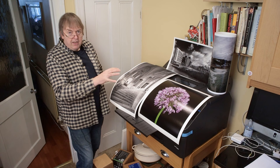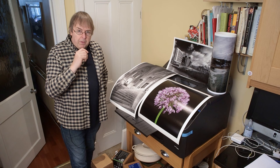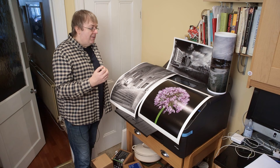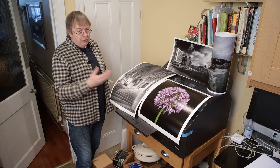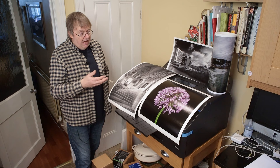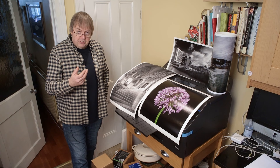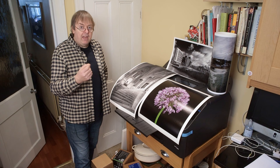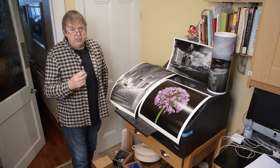I've mentioned the P900 and the P5300 here — or 5370 as it is in the States; the model numbers vary a little bit. What about others like Canon? Canon has the Pro 1000, which is an excellent printer — it still has some of the best paper handling. In fact, for 17-inch desktop printers, it had the best paper handling until the P5300 came along and nudged into the desktop market. You need a hefty desk to stand it on, but the paper handling for sheets is every bit as good as it is for the Pro 1000. The Pro 1000 doesn't have roll. That's quite an old printer — Canon may well be bringing something new out this year. The Pro 1000 is great, but it does have a habit of using up quite a lot of ink in cleanings if you don't use it much.